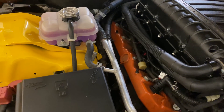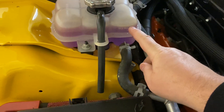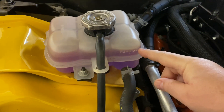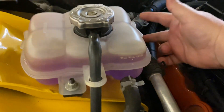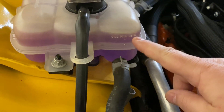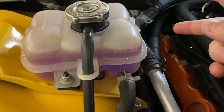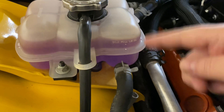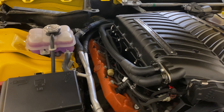The problem when you do that is the intercooler pump pulls so much coolant that this size line is not enough to keep up with it. This is a chambered reservoir, so it was sucking the chamber dry and introducing air again. What we ended up having to do is apply our clamp here, pinch it off all the way, but watch: as soon as the level in this chamber started to drop, you had to let go. But as soon as you did, you'd hear or see some bubbles popping through on the back. So you pinch, watch the level drop, let go — repeat until you hear the pump down here with a constant, steady noise.